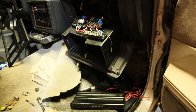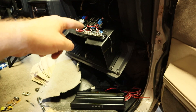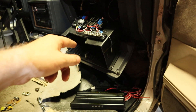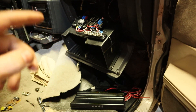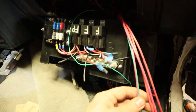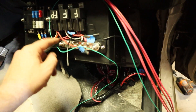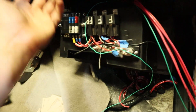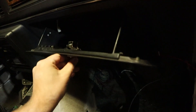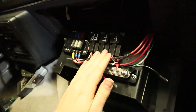You can see where we put the relay panel. I'm now going to put the Terminator ECU up against this wall and start routing my signal wires to my fuel pump, fans, and boost control for now — I plan on adding flex fuel and some other things later. I've got my fan wires going to my fan relays, got my fuel pump relay, and a signal wire that'll run to the Holley. I've got everything from my old setup repurposed here.